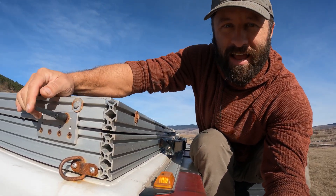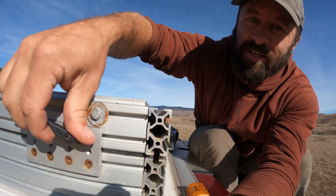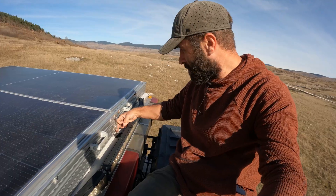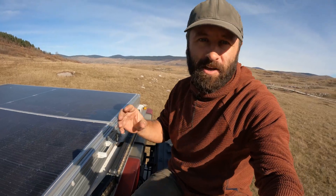For locking the upper panels in place, we have little levers — one on each side — that go into the unibearings and lock them in. As an extra precaution, I also have one in the center, which is a simple pop latch that fits right into the extruded aluminum slots. I have not had any issues with the panels being insecure at all and feel perfectly safe driving down the highway. I always triple-check that they are locked every single time — that is key.